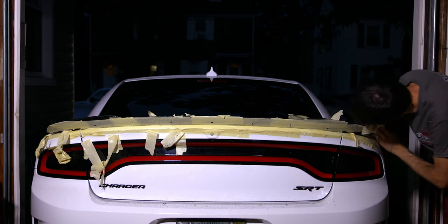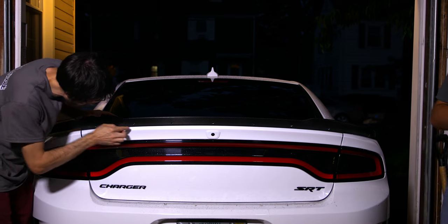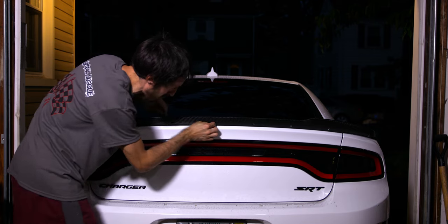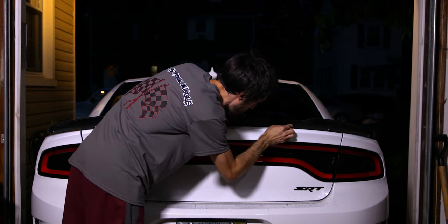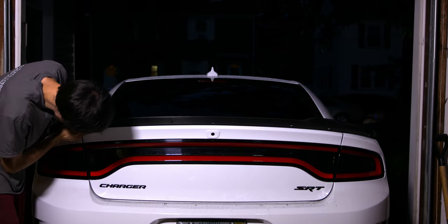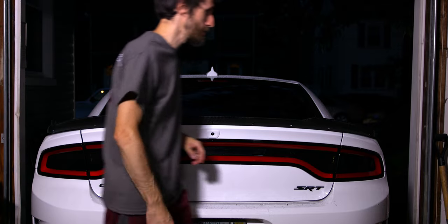Now I'm going to take off all the tape, leaving only the holes where I can install the rivnut. Take your finger gently — even if you don't have vinyl, you want to make sure to push inward any debris. Don't pull off the vinyl, especially if you've got vinyl — tuck it in; the rivnut will push the rest in for you. There are a couple of holes — maybe two or three — that have a little bit of a ridge where the plastic came out. The rivnut must be completely even and flat, so I'm going to get something to flatten this out before installing the rivnuts.